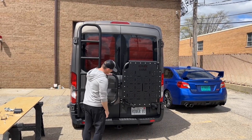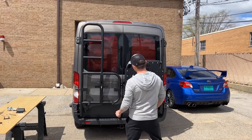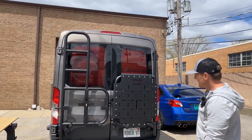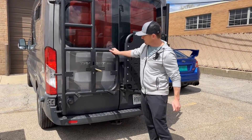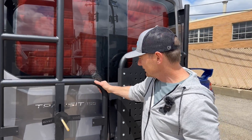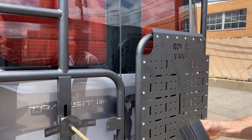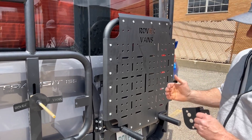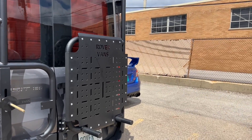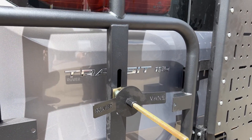We find this is a cleaner install — I think it looks better and the doors close very nicely. The main thing is you're not messing with the gasket and you're not putting anything in between the doors. It wasn't actually a problem at all — we just found this method is better. The main advantage is it eliminates vibrations on the door. Eliminating the third bracket allowed us to have a system that moves a lot less, hence it's better. So yeah, this is your ladder tire carrier install with a drill-through bracket that we highly recommend using from now on.